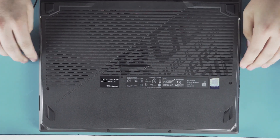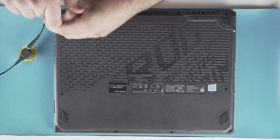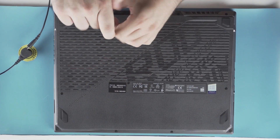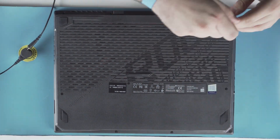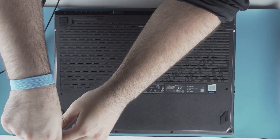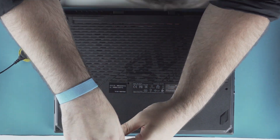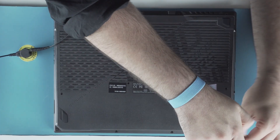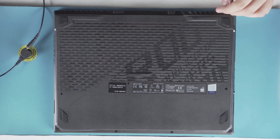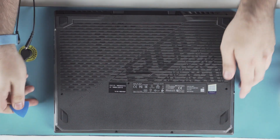Flip it over. It's very similar to other laptops we work with. All you're going to need is a Phillips head screwdriver. Make sure you lay out the screws in a grid pattern so you know where you took them out of. These corner screws near the front of the laptop do not come out — just unscrew them. And again, this other corner screw at the front does not come out, just unscrew it all the way. Once you get to this point, all you're going to need is one of these guitar picks to help you open it up.